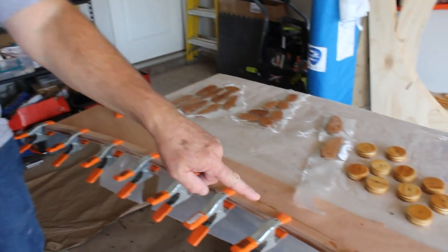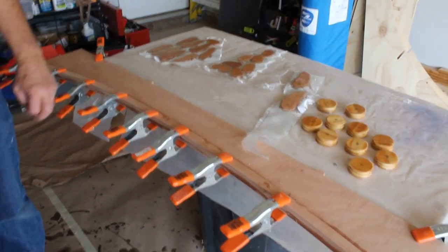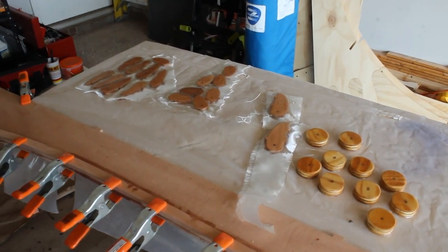We resined and coated the inside top of the camper. We have constructed the shelf with the catcher ledge, and we have fiberglassed the hinge pieces. So next week we'll get in here, we'll turn this thing upside down on top of the trailer and bolt it down, finish these hinges up, install the shelf, and probably get around to, if we're froggy, building some door frames and some doors.